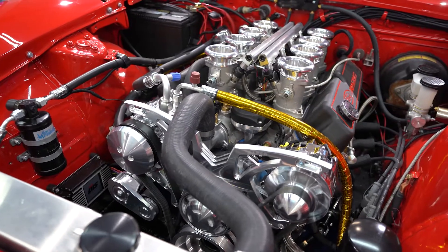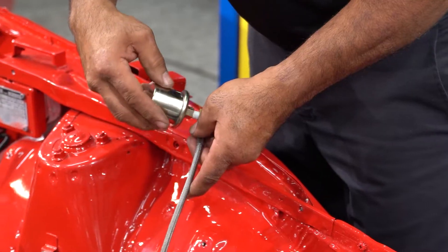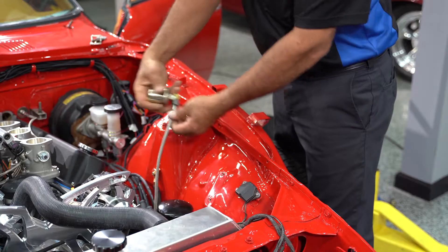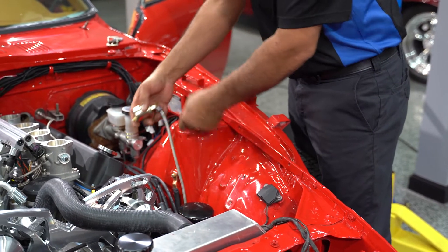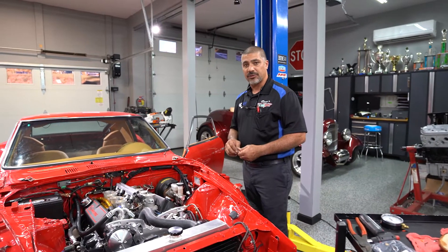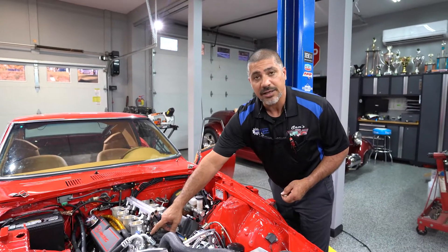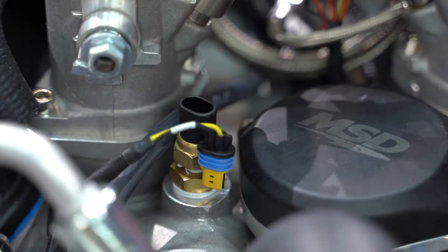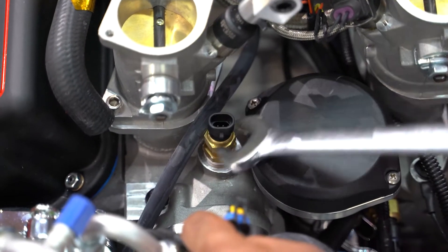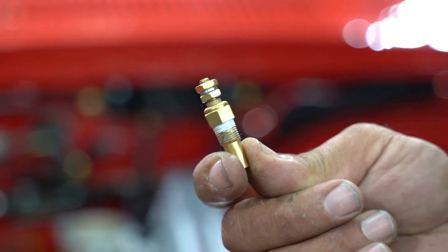The sending unit right here — if you guys remember, we cranked this car up a few weeks ago. Because of the space, I didn't have any room to put the sending unit in the right spot for the Fords. So I made a mechanical gauge with a remote line that Autometer sells as a kit, anywhere from 24 to 48 inches. You can remote mount this anywhere on the chassis of the car, giving you access to it — it'll be nice and safe and will never break off the engine. For water temperature, this engine has two spots I can get a good reliable coolant temp from — one the MSD has, the other the Fast EFI has. I never modify spark trim with ECT, so I'm going to take out the MSD ECT sensor and put in my Autometer sensor for a good accurate water temperature reading.